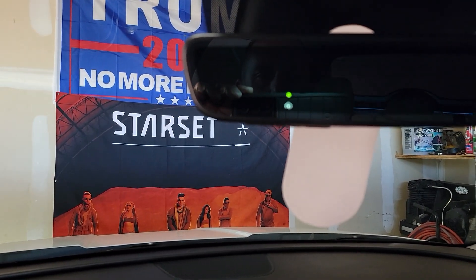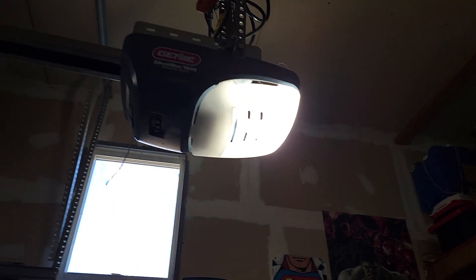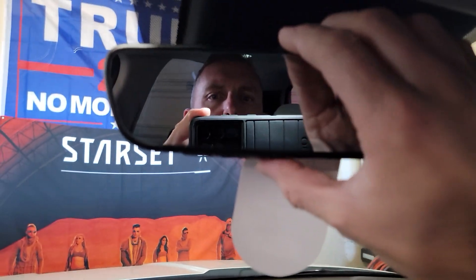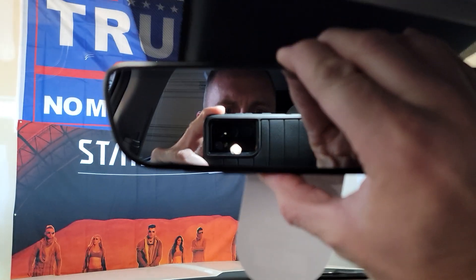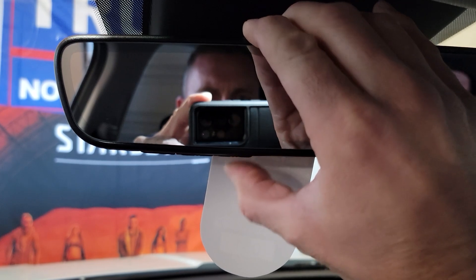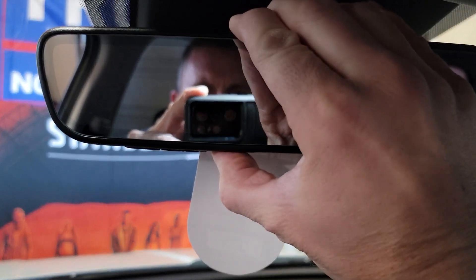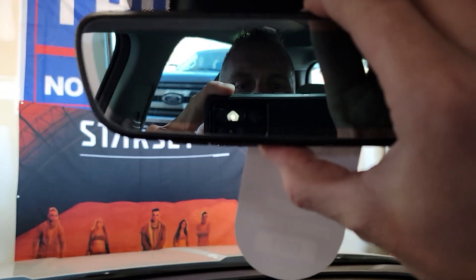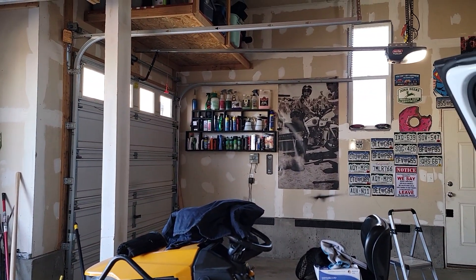Now that button is trained. Let's go to the second garage door opener. For Genie units they're all pretty similar, but this one actually says 'Set and Program' — it's a slightly newer model. Push and hold the learn button, the LEDs come on, and once they start flashing you've got about a minute. Back in the car, push and hold the HomeLink button — it's blinking slowly as it tries to sync. Keep pressing until eventually it reaches the door and activates it.